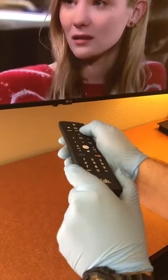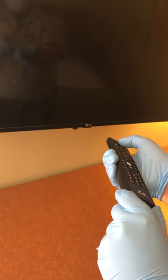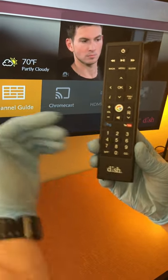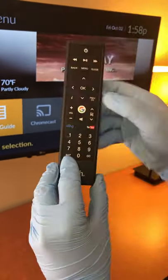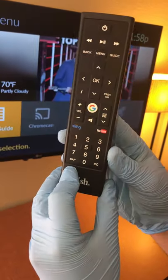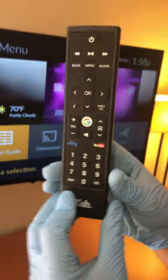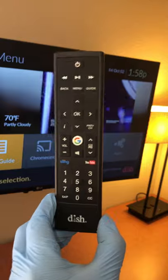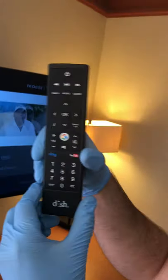Volume controls work, guide works, I can turn the TV off and back on — the remote's fully functional. To recap: use SAP and number three to turn the TV on and off. For volume controls, do SAP and the OK button until solid red, then hit the volume up plus sign once and CC button once while pointing at the TV. If you still don't get volume controls, start over: do SAP and three to shut the TV off, turn it back on, and check volume. Repeat the steps several times if needed, and if all else fails, get a new remote and do it all over again.